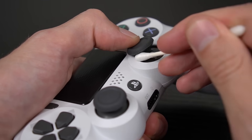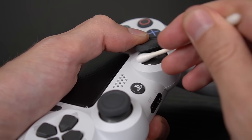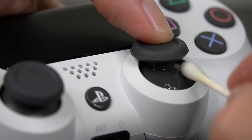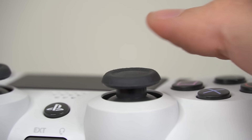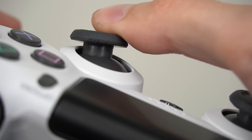To do this, I recommend using a q-tip and a small amount of rubbing alcohol. Simply clean under the analog while rotating it in order to be as thorough as possible, then flip the q-tip to finish it off. Once you're done, check the area to make sure there is no dust or residue before you continue. If you missed a spot, just repeat the process.